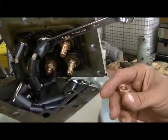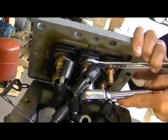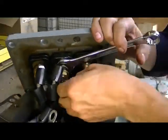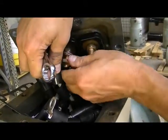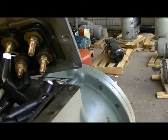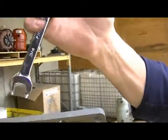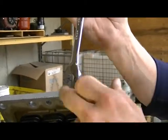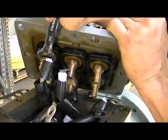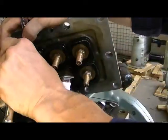Here's the lock nut screw, and here's your actual screw and washer. You have to hold the top of this stud — this is the stud here, and that's not a nut, that's actually cast. This is a cast stud. This is a three-quarter inch that we've ground down so it'll fit in between. A standard three-quarter inch will not fit in there. You need a thin one — they sell a thin one, or you can go to Harbor Freight and grind one down. They're a dollar.